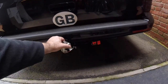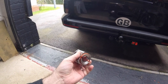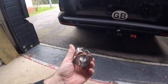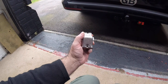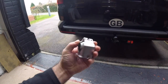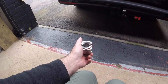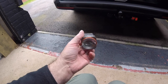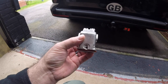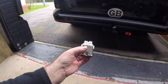The clamshell simply comes off the tow bar. The elasticated ring on the bottom — the little orange thing that you can see — is simply there to hold it together so that you can guide the rack down safely. It has two grub screws; you can just about see one on this side and one on the other. This universal fit can go either way, it doesn't make any difference. The grub screws protrude very slightly from the inside, so once you align the back rack and tighten it up it will leave a small mark on your tow bar, which can be an issue if you're having problems with the rack moving from side to side or swivelling on your tow ball.